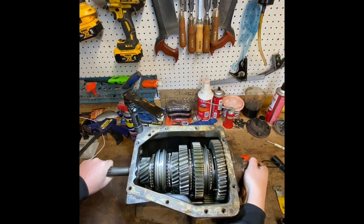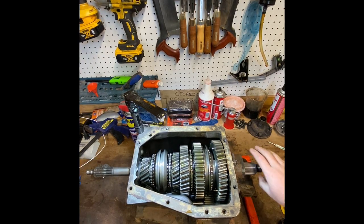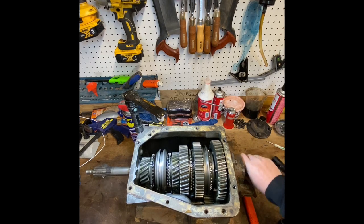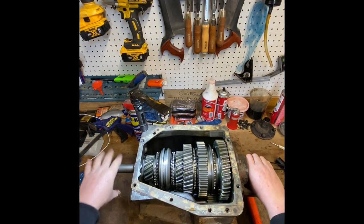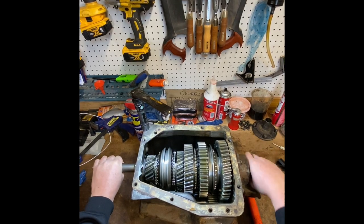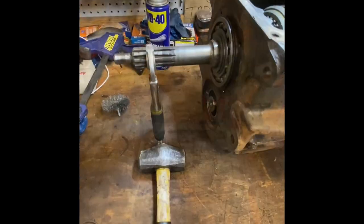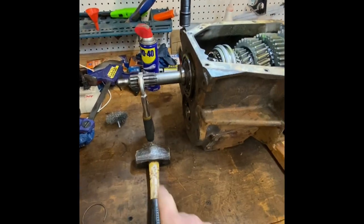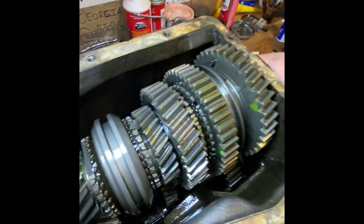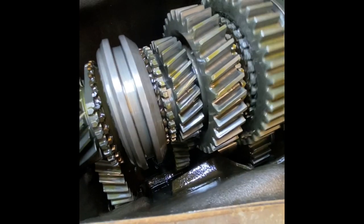Now you can see I can hold the rear shaft and turn the front shaft. More importantly, I can turn the rear shaft like the drive shaft would if you were flat towing. Now that does spin unless I put some force on it, like I'm the clutch and the engine — and now it no longer spins. I had to enlist the help of some vice grips and a hammer because I've only got two hands. Now if you turn that output shaft, and the input shaft is not turning, you can see that the counter shaft no longer spins.